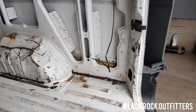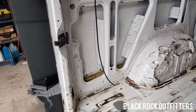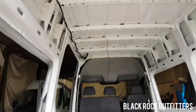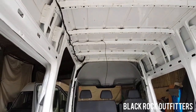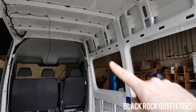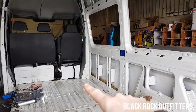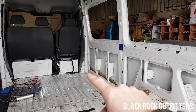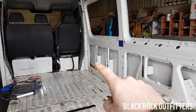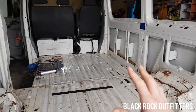Okay, I'm back. So as you can see, there is a USB feed in there, which comes across to there. So that's one feed. In the roof, there is another feed. That is for the four spotlights. Over in that corner, I've got a feed just there. That comes for the galley lights, which shine down onto the worktop. That's feed three. In this conduit that comes around there, I've got feed four for the tap and feed five for the fridge. That is it.